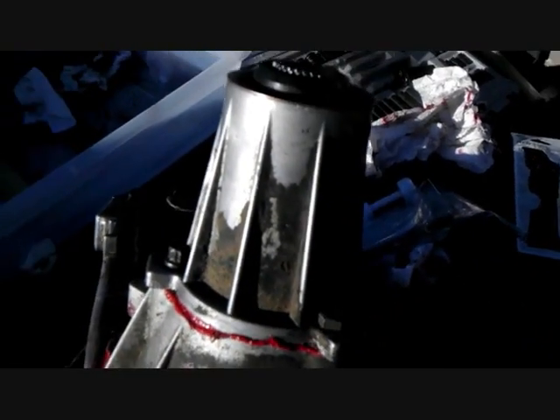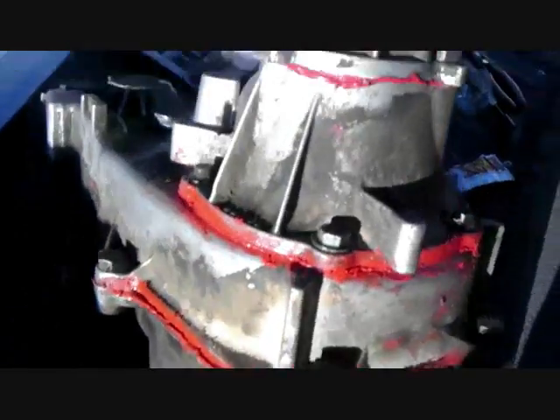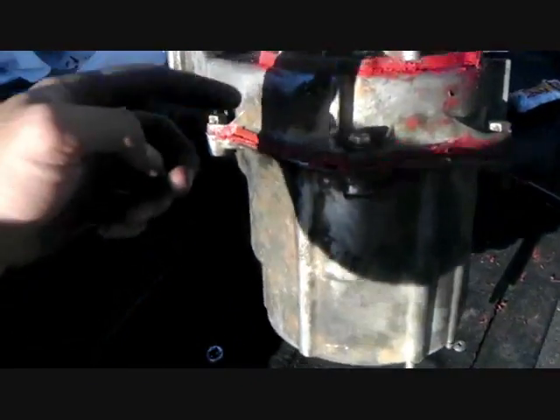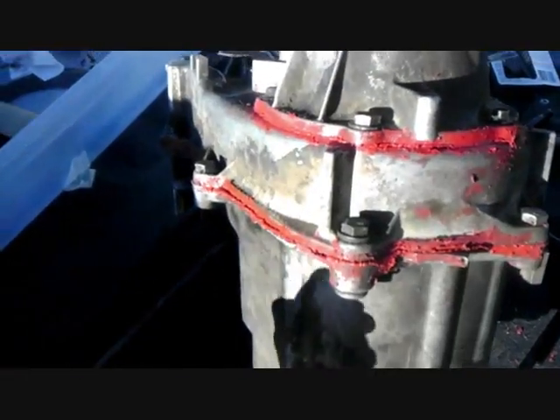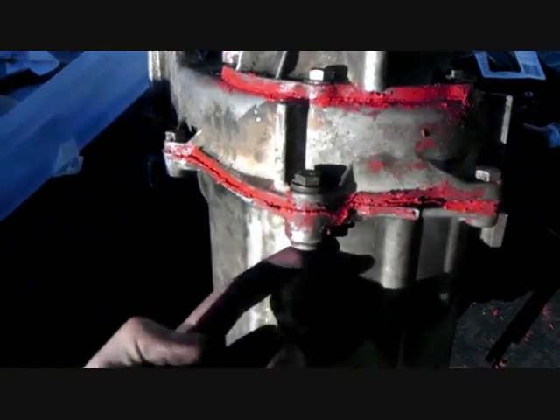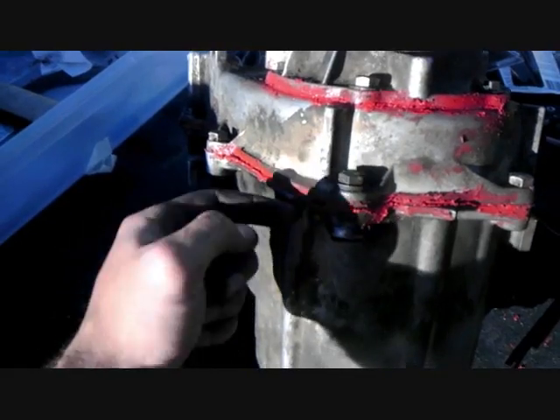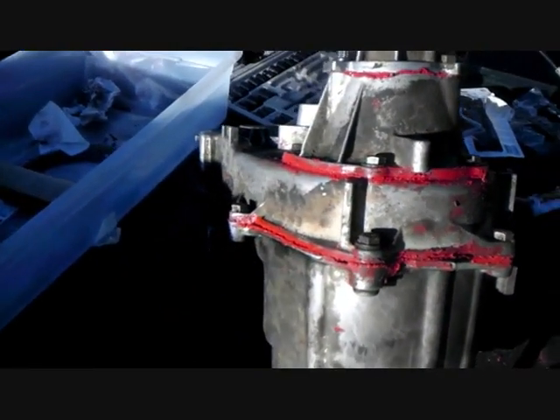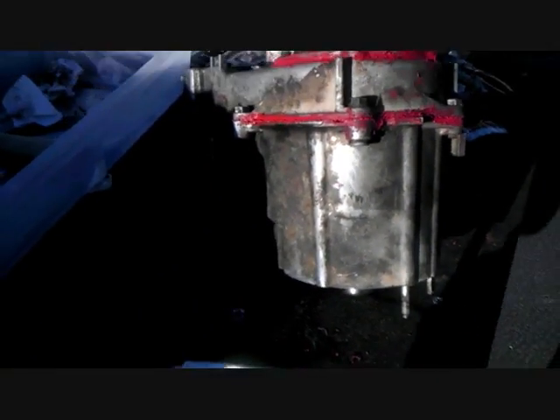When putting the whole thing back together, there are a few bolts that aren't the same as the rest. The one up at the top is one of the different bolts — you need a different socket head for that, I had to buy an extra one. In the second layer, on the corner of the transfer case, it's this one. On the bottom layer there are two that need washers — they're the same ones that have the little guiding rails when you put both halves together. So all of those will be the different bolts when putting it all together. Anyway, it's all done now — just got to put it back in the Jeep and hopefully it all works.